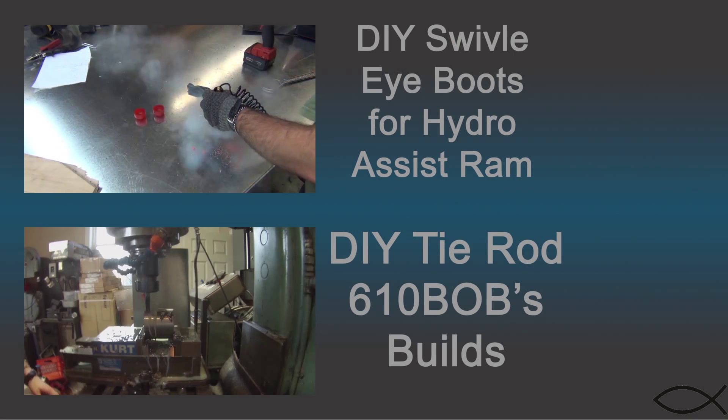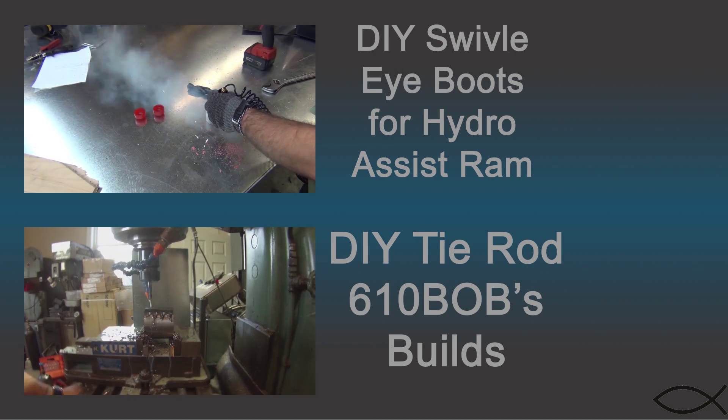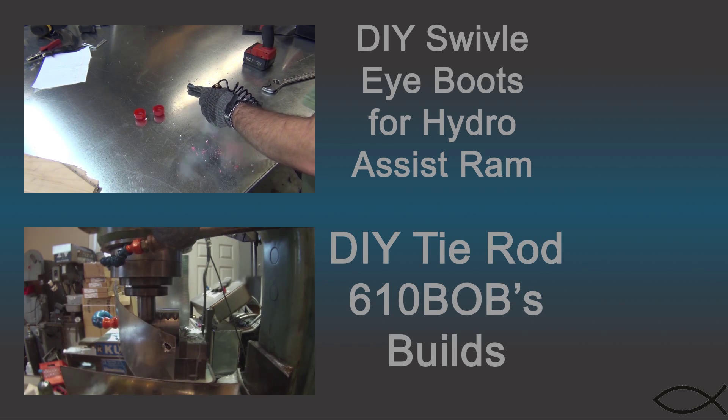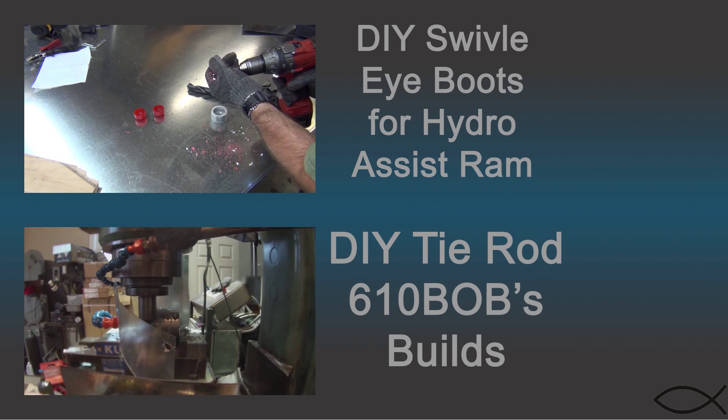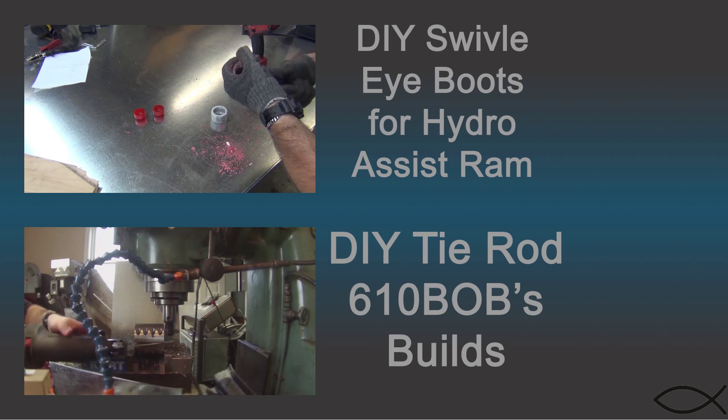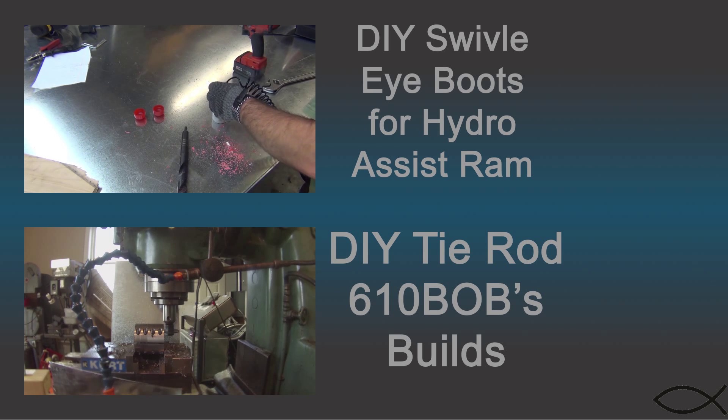So be on the lookout for that. Using the kit's — I don't know what to call it — it's the part that goes into the clamp and fills the clamp with liquid CO2. Anyway, using that thing, I froze the tie rod end boots by spreading them with liquid CO2, utilizing the failed mold as a holder.